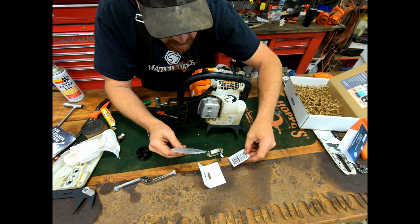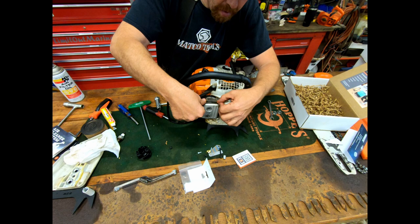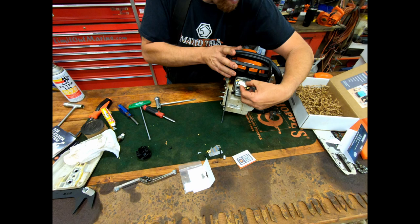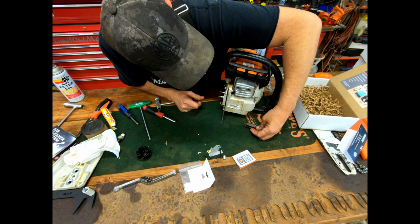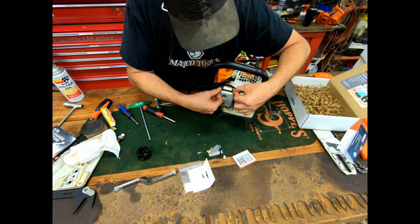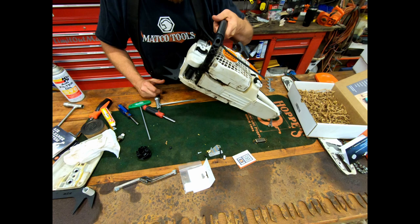He figured out these little rivet nuts and includes a little tool for tightening them down. The problem I have is everybody puts the port on top, but I've got that bump there, and putting it on top gets too close to the chain brake — when the saw is hot and I set the chain brake it'd be really close. I don't think I can put it underneath because it'll touch the plastic tank, so I'm going to try putting it right on the side. I might need to hammer out that little corrugation — worst case I'll have a dent in the muffler and I'm not worried about that.